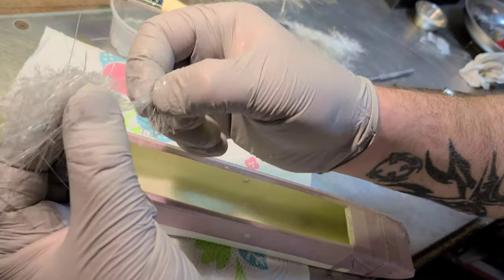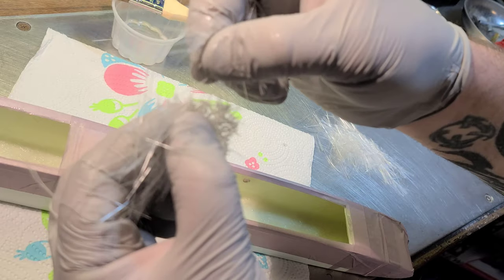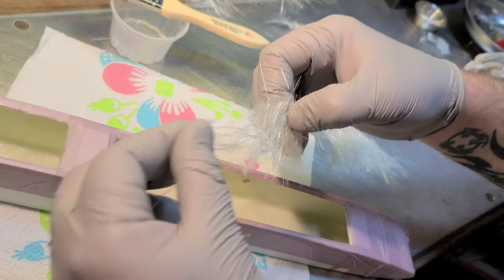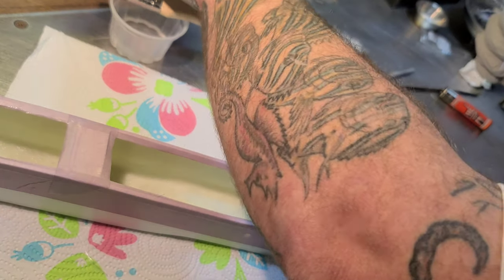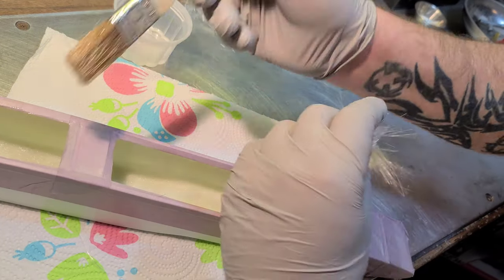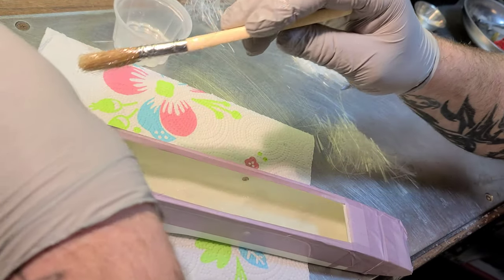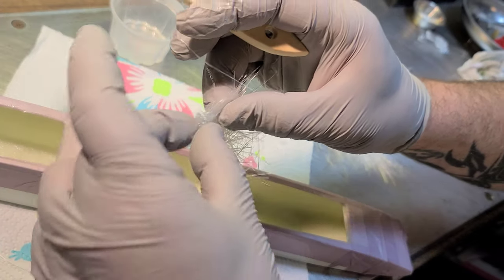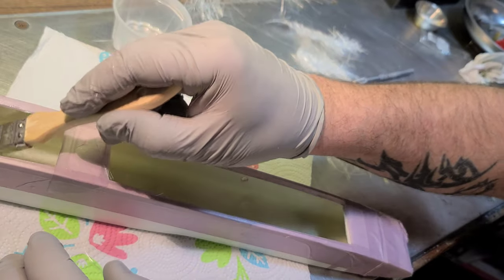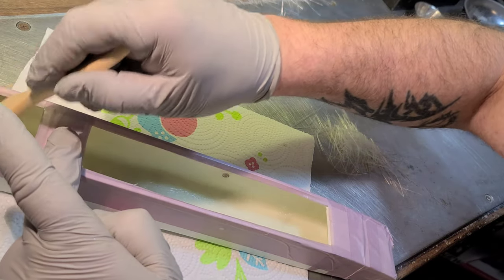So what I do is take a little bit and pull a little bit of the cloth off. And I'll save this stuff for like the boom tubes. Perfect example for this stuff right here. Just that loose hair. Alright. Let's get us a little bit of epoxy back here. Okay. I'm going to put that cut edge, the cut part, toward the top. And we'll take the hairy part and wrap it around the back transom to the bottom of the boat.